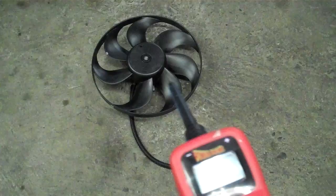You can see the fan in the back part of the frame. I push the rocker button forward and it sends power. I'm on the middle one — it shows ground now. When I run power to it, you can see it kicks the fan on. When I go to the next one over, that's high speed. So when I did this to the fan that was in the car, there was no response. I had it full of antifreeze, all topped off, and no dice — the fan was not coming on. When you run power to this fan, it also sends power across to the other fan too, so expect that this fan is going to come on as well.